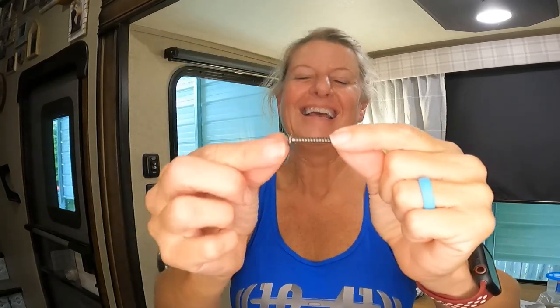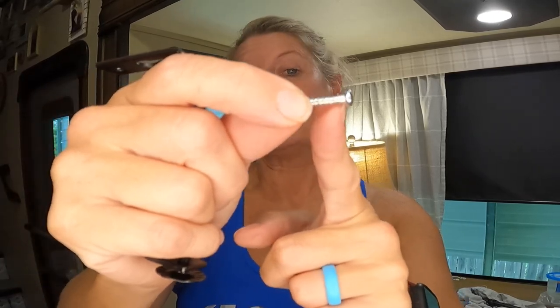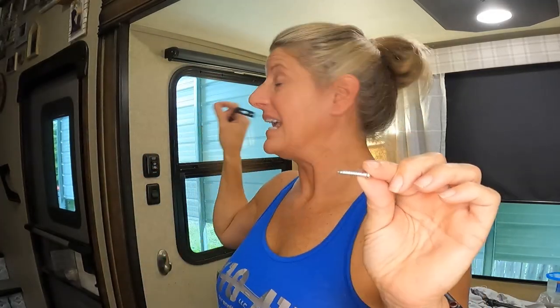Let's talk screws real quick. If you were using the block of wood and you used the screws that came with the curtains - it's a longer screw like this - this would work if you were going through that piece of wood into the wall. If you use this length, it would be really close to coming out of the outside of the wall because in the slides, the walls aren't as thick, and you might penetrate to the outside. So make sure your screw length won't go through your wall. The new brackets came with a shorter small screw that will work perfectly. The thread goes all the way to the screw head, which is better for an RV wall since it's hollow. You could even put in anchors, but it's never been a problem just using these kind of screws.